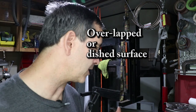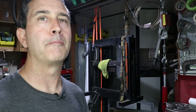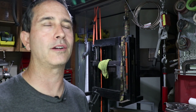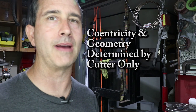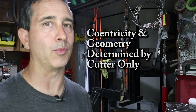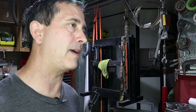So that's why I use the 400 grit compound. It's technically, you're still lapping, but it's so fine, you're not really removing any material or changing the shape. So I thought that was worth mentioning. Lapping valves is something that most people don't do anymore, because CNC machines and all the valve cutting equipment has gotten so much better. The chatter marks are kind of a thing of the past, but because I did mine by hand, I took the most precautions I could.